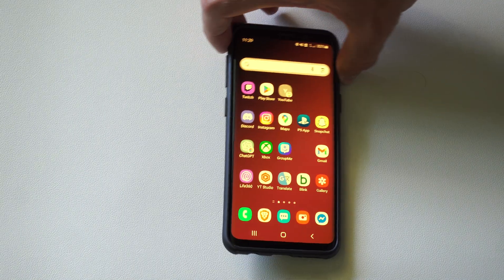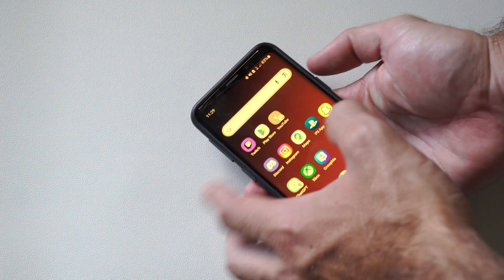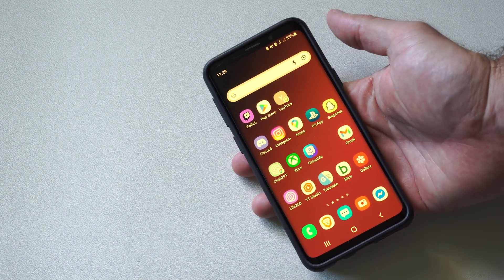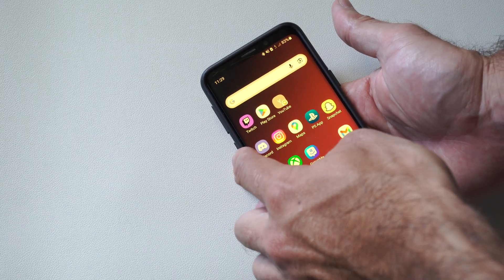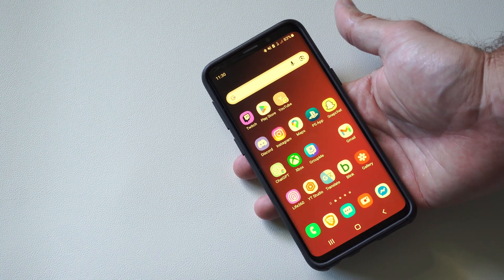What you want to do is manually turn it off. On the Android phone, any version, you can hold down the volume down and the power button and this will force turn it off. Then when it force turns off, we want to hold down the Bixby button, the power button, and the volume up key all at the same time.